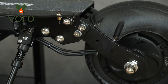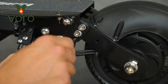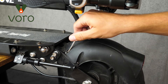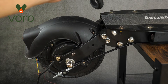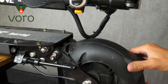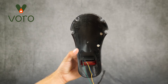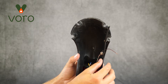Now we're going to remove the old fender. To cut your fender wire, come in with a pair of wire cutters or a razor blade. There are two wires back here — make sure you're not cutting the motor wire. The motor wire runs to the motor while the fender wire runs up and inside the fender. The fender is held on with four screws, two on each side, so go ahead, grab yourself an allen wrench and start loosening those up. This fender is broken so I didn't have to remove all four screws to take it off, but you will want to remove all four screws.